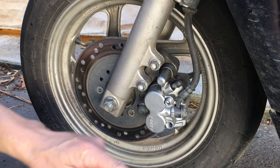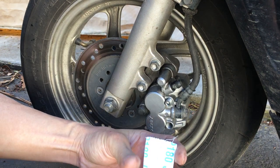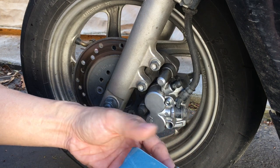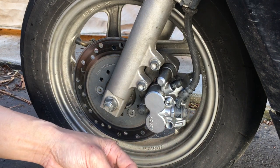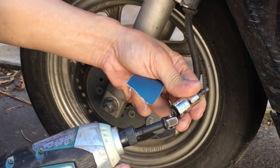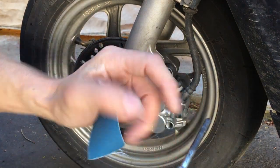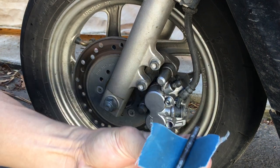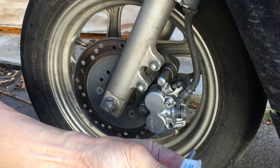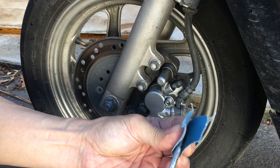I think that drag is potentially what's causing my brake pads to wear out faster. So I'm going to sand this down. I have 180-grit sandpaper — it's plumbing copper pipe sandpaper, the only sandpaper I have. I'm going to connect it to my impact driver with a 5-millimeter Allen for the head right here, just spin it, and hopefully this will go pretty fast.